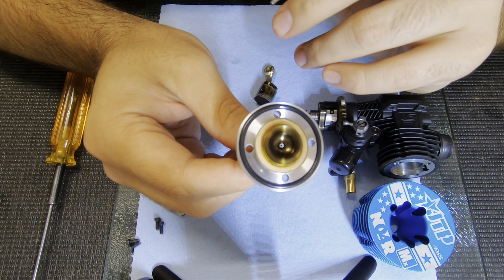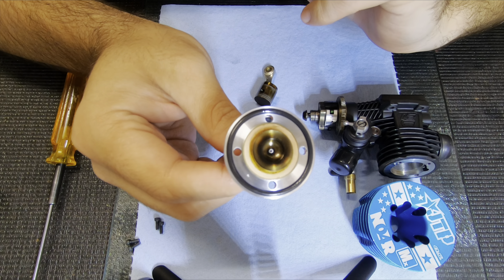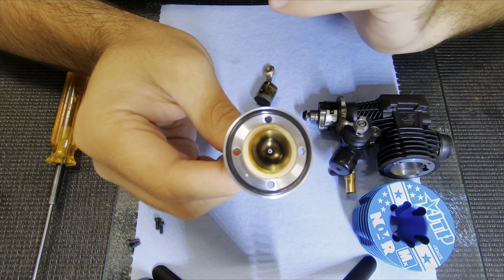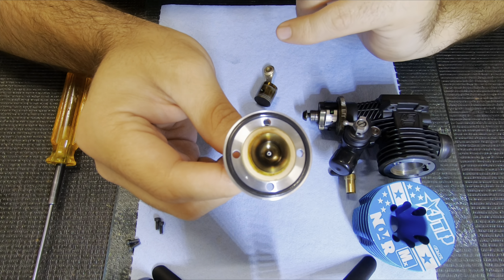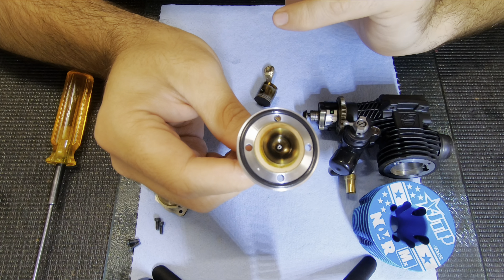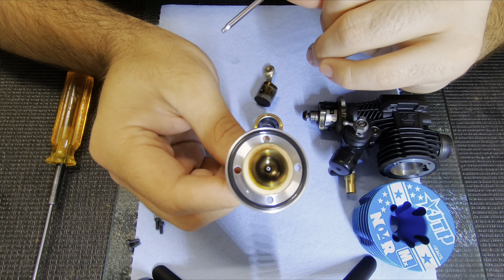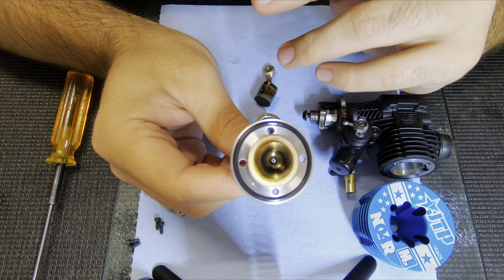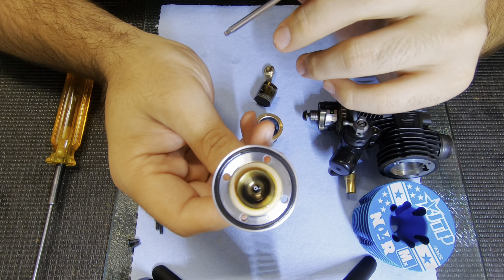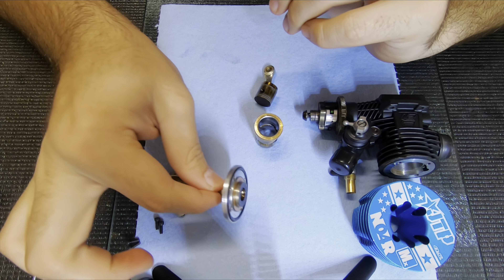It's got that crisp factor you're looking for when going for crispy tunes and fuel mileage. Personally, on a pretty aggressive race tune, clutched aggressively, I was getting about eight and a half to nine minutes worth of run time with this engine running a six millimeter venturi in my nitro buggy. That was the footage from Adrenaline Raceway you may have seen on my channel with the B4. Good color pattern — nice golden brown — and it's got carbon buildup, which is not a bad thing. I hear many people in racing think the color buildup is bad, but all of this just aids with protection and longevity.